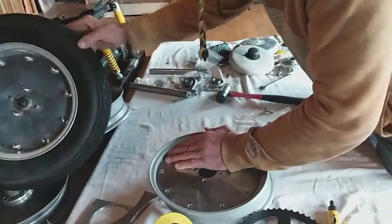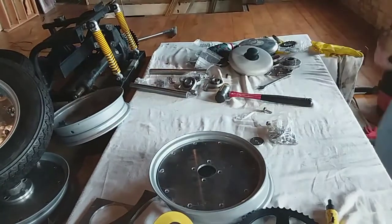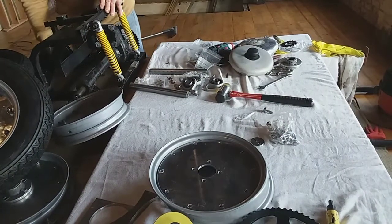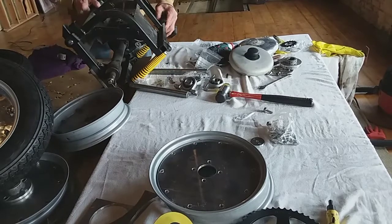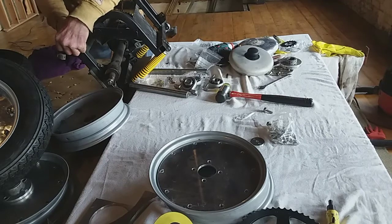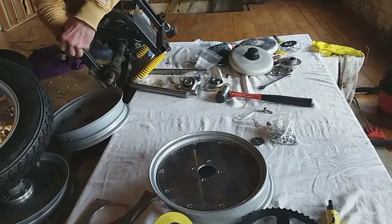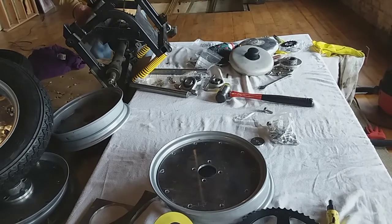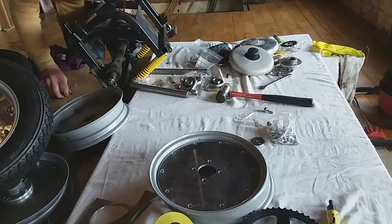One other quick thing - I'm working it up as I go along, that's what I love about all this. The swinging arm - where the swinging arm goes on, where they only put M8 bolts through here, which is a bit Mickey Mouse. I've drilled it through with an M10.